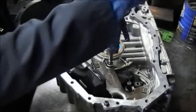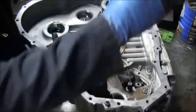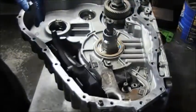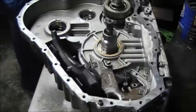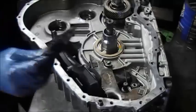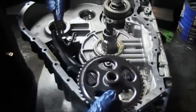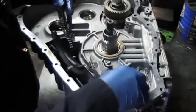Okay, now the bolt we're tightening is the number 10 little bolt that you had left inside the case so as not to lose it. So now you got the bottom chain guard down. What should be going on now are the pump gears. Now look how it goes down. The long nose on this part goes down.